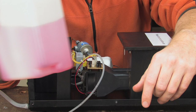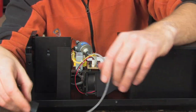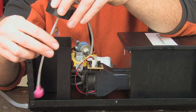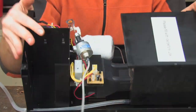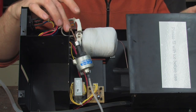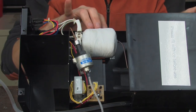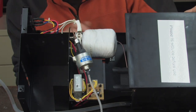This is looking a lot simpler than I thought. We have the liquid fog reservoir. It comes into the machine here through this little weight which sits in it, and then into this tube which goes to a little pump which sits right here. From the pump it goes into this copper tube which is then routed into this mass of Teflon tape and what looks like cotton balls — it might be asbestos or something.